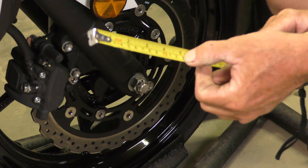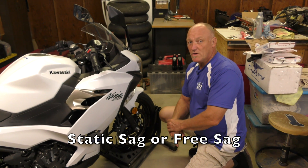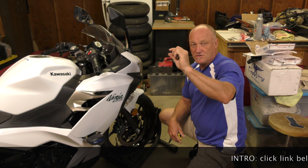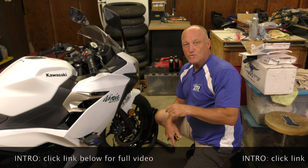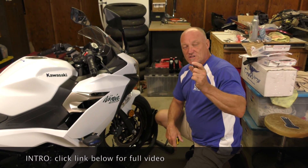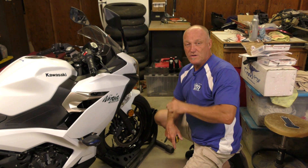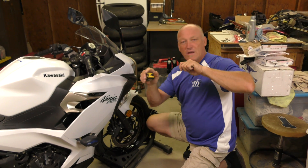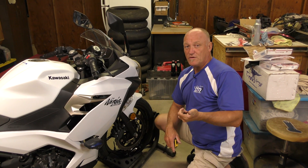What does static sag mean as a number? Your minimum ideally is 20 millimeters. If you have less than 20 millimeters, there's very little top-out space — just like a rear shock at the back. What that means is, with a big bump because the front wheel hits first, there can be a sharp whack into the forks, and almost everybody watching has felt that — the bars bang in response. More generous static sag, 25 or maybe 30 millimeters, allows a much bigger dead zone for the suspension to absorb the hit. This is more important in the front — guess where our hands are? We're steering. If that bang makes us react, the bike can change its line, sometimes dramatically. Higher static sag numbers in the front can make cornering much safer, but also much more fun.